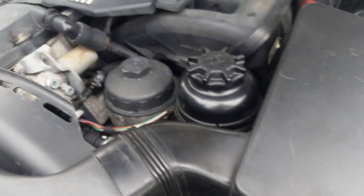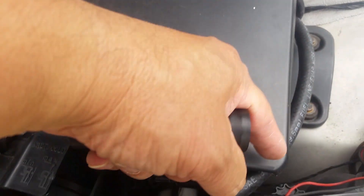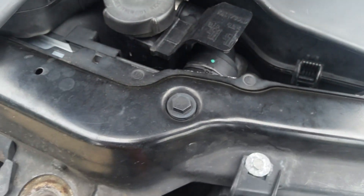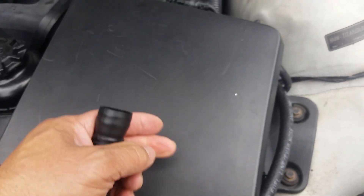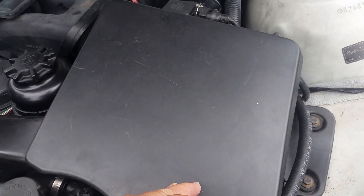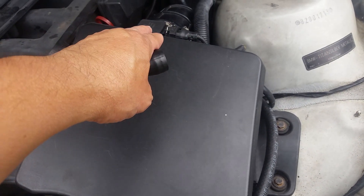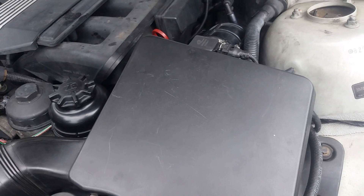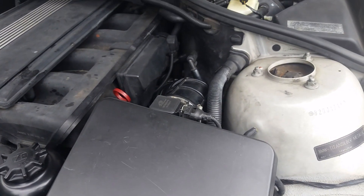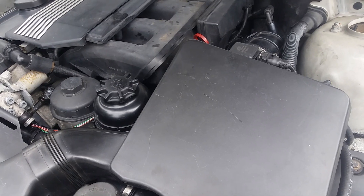Since it's venting, I'm going to allow it to come out naturally, go through here, and when the motor's running it'll just suck it right through. It'll come in through the top, the air cleaner will filter out the smoke, then it goes through the MAF and burns. It saves me getting a catch can, finding room for one, and draining it.